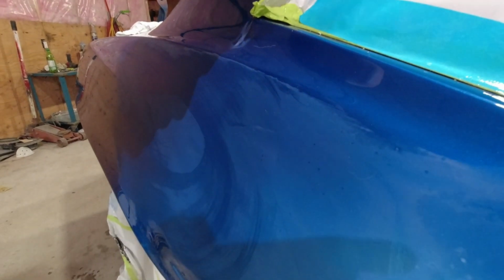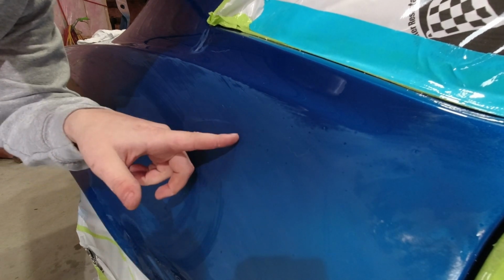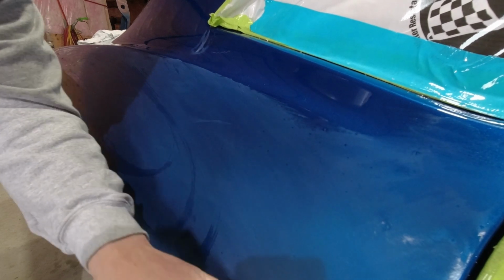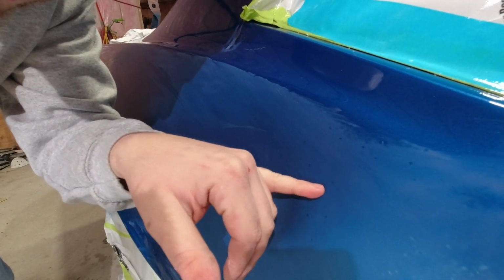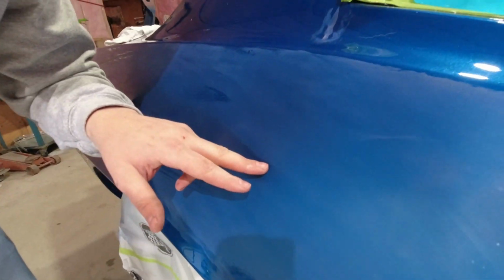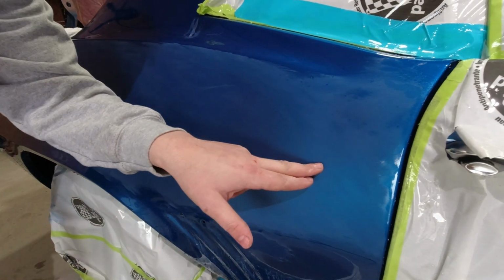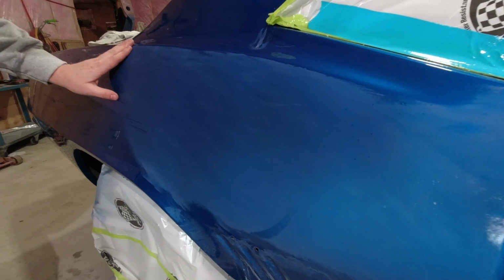Around to the back of the camera so I can see a little better. I don't know if you can see where it's sanded kind of matte on the surface where it's high, and then there's little tiny dimple fish eyes in there. So I think that's as far as I'm going to go with the 1200 here. I got a lot of it out. You can see it's really shallow there. Might hit up here a little bit better. We still got some shiny flat spots, so I'm gonna do that.